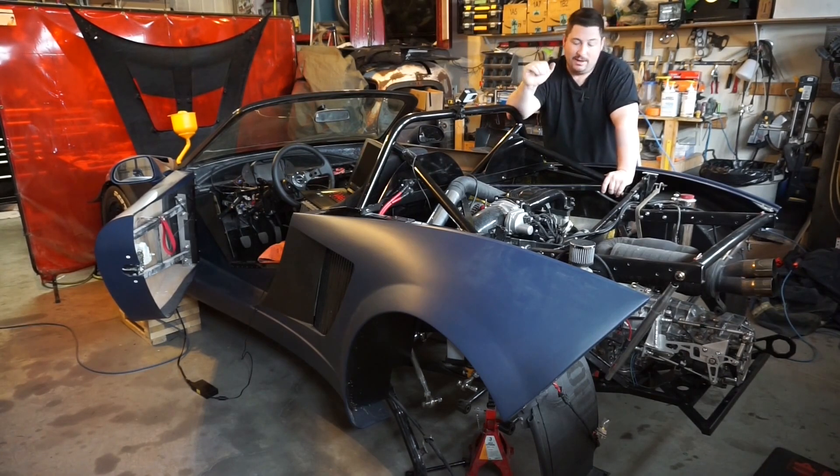While I'm checking for leaks, monitoring oil pressure, and bleeding the coolant system, I don't want to be worried about tuning idle. So I took my idle basemap and just changed it all to 2000 RPM. I hope to get the idle much lower — wherever it seems happy — but setting it to 2000 will keep it running. I've got closed loop on, so it'll be reading the O2 sensor and compensating enough to just keep itself running.